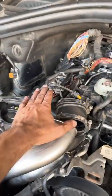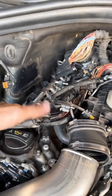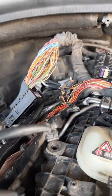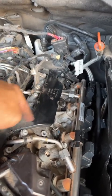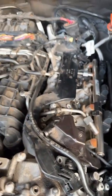Quick update: I chased everything down all the way and couldn't find the oil on this side. I've opened everything on this bank of the harness and there's oil here but it's not coming from this side. It seems like the oil is coming from this side of the harness, which means it was either one of these two sensors over here. So I'm gonna chase the line and see how far I get.